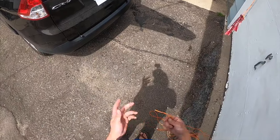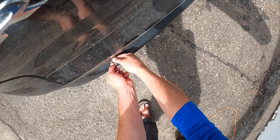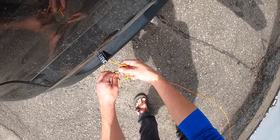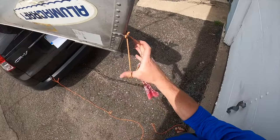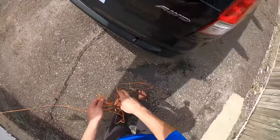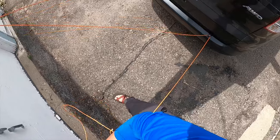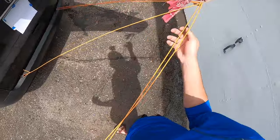Here at the rear end of the vehicle I also don't have great integrated tie-down points, so I've used more of those hood-style straps. I feed through one and do the same process as the front — tie a bowline — and here I've got a piece of rope girth-hitched through, with my painter line and red flag integrated, which keeps all my pieces organized. I feed back through, utilize the extra rope to give myself a second set, and tie a modified trucker's hitch. Once secured, I tie a stopper knot to keep it from disengaging, then clean up the rope with a nice coil.